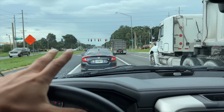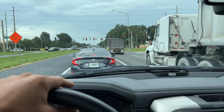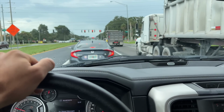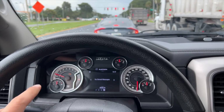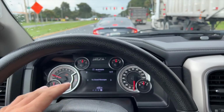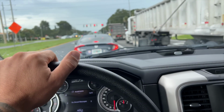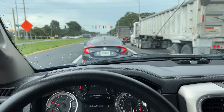But I'm hoping that, apparently in these Hellcat valve covers, there is like a baffle inside it. Maybe something inside of that is what's making this screech noise, because it's weird. It only makes it under vacuum. As soon as you start punching on it, it goes away. So fingers crossed. I'm praying that it's just that, because I really don't feel like trying to switch a transmission right now, you guys. But let's get back and see what happens.